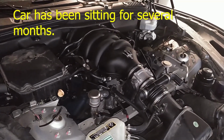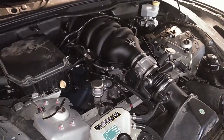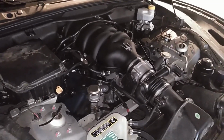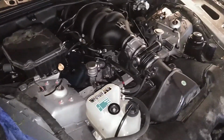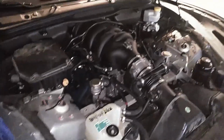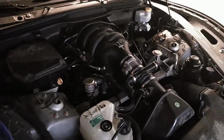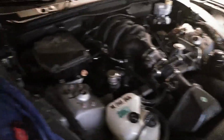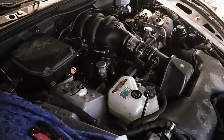First thing we're going to do is put the cam holder on that piece there. We got the screws here. Let me unpack that. Also got to put this guide in place and get that on right down there. I oiled the underside of that cam cap where the cam will run, set it in place, then I set the guide in place. Now I'm setting the screws in place, and then I'll set the sensor on it.